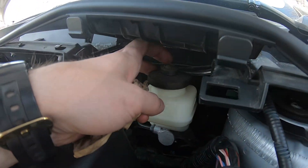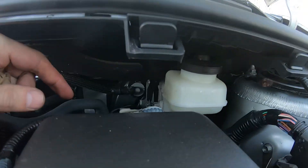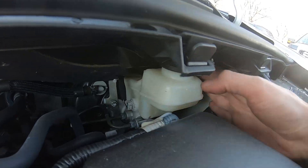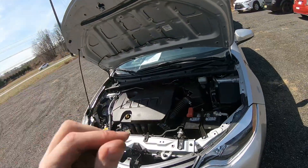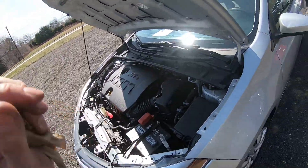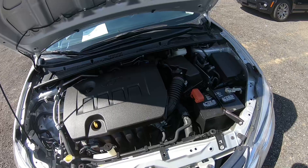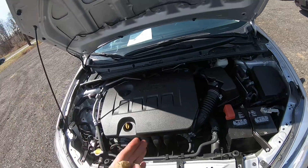Next thing in this car is brake fluid. This car uses DOT 3 or DOT 4 brake fluid. On the sides you have max and min signs, and the level should be somewhere between those — you can see the fluid level right now and it's good. If you are missing some fluid, most likely you have a leak somewhere, because brake fluid doesn't evaporate. Be careful with that because you might lose brakes.